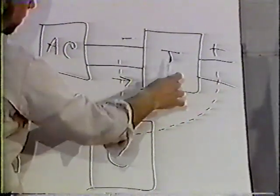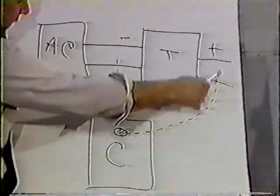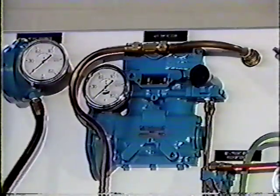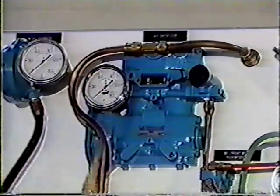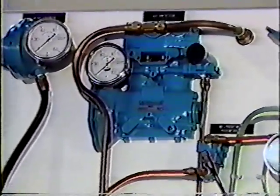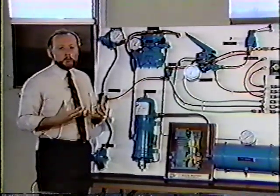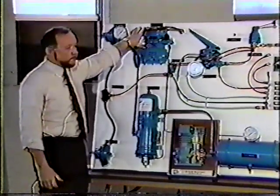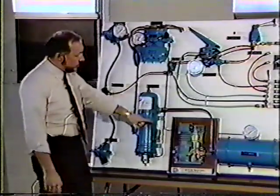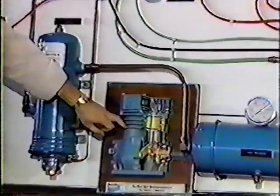Turbocharged is a good setup because you are sending pressurized air up, say, perhaps 28 PSI into the compressor, which will help keep oil down in the crankcase of the compressor. The compressor has to be cool because that head will get pretty hot from that compressed air. There's three different ways we do that. Actually, there's two ways, but three different designs. There is a straight water-cooled compressor, which is this style right here. There is a completely air-cooled compressor, and then there's a combination of the two, which would be this style right here, where you have a water-cooled head and an air-cooled block.